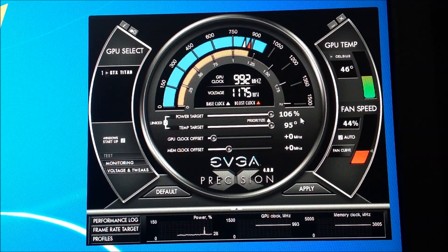I assume that's because of the wattage threshold — I think it's 250 watts basic, with a peak of around 265 watts. So there's not as much headroom on the Power Target compared to the GTX 680 or similar cards, where with the older Precision X you could slam it to 120 or 125%. The Temp Target is brand new — there was never a Temp Target before.